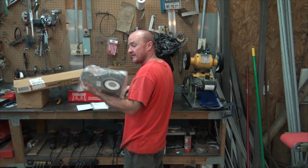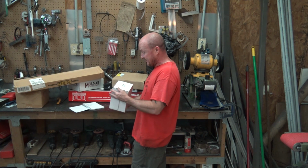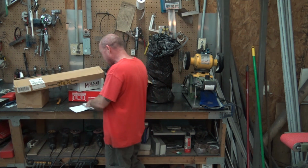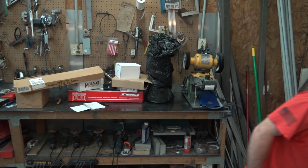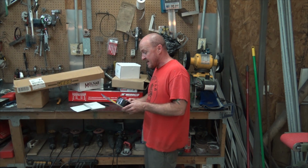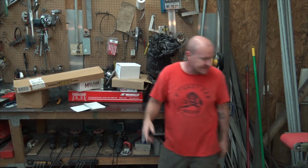So we got the back housing for this guy, and the gasket, and the main set, which is good. Yeah, this was just a regular OEM replacement oil pump. No need for high volume or high pressure or any of that. You don't have to get high anything. Then we got a ring compressor, which is mated for our pistons, which are 5 thou over standard 4-inch bore.